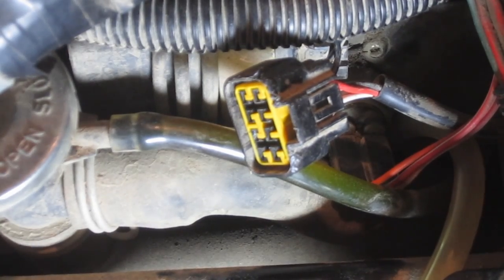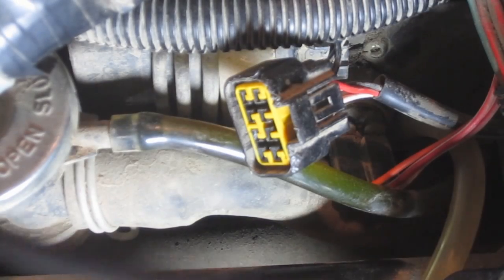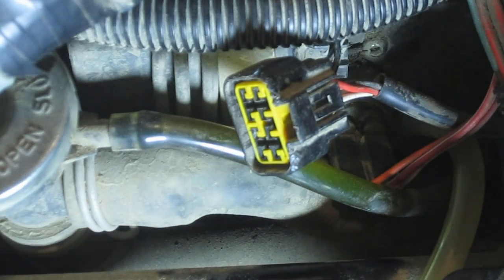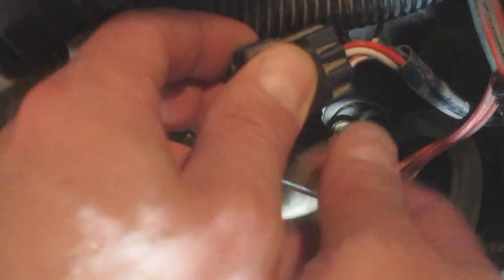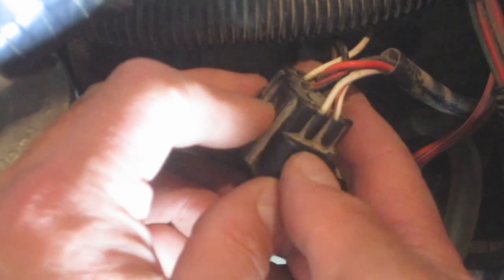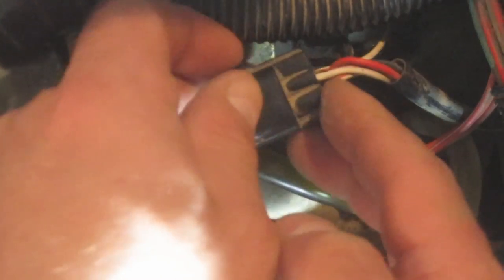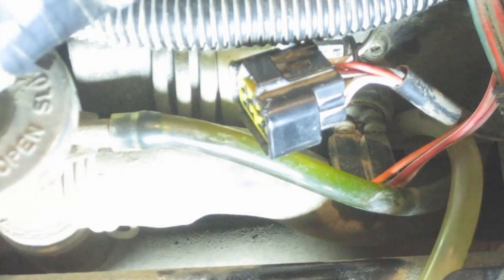Okay, so one of the procedures on the flow chart tells you to test the pulse coil, or in this diagram here, they're calling it the trigger coil. So it's white to white-red. It should be 97 ohms, and then you test white to ground. Here they call it the trigger coil. So what you need to do is identify those wires, white to white-red. That's white-blue. So these two here side by side.